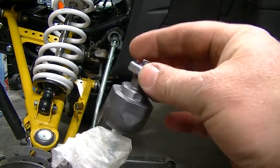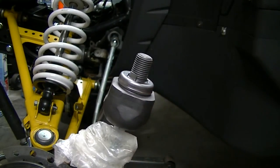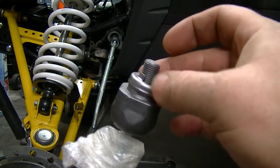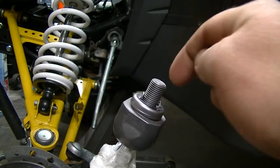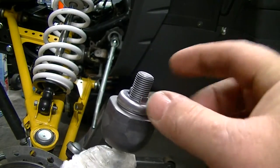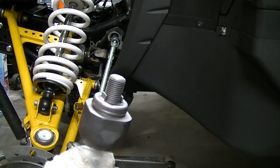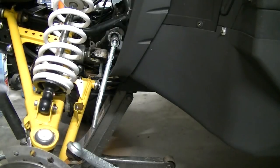I'm going to show you on this new tie rod. Yamaha uses this locking retainer ring once you get it put in there to keep it from backing out. You put it on there and where all these little indentions are on the tie rod, you pin it with a punch or screwdriver or whatever. These little tabs here actually lock into the actual steering rack. The problem is there's really no way to undo these to get it out, so we'll just back it out.